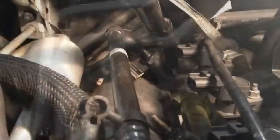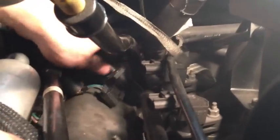So before you take off the valve cover, you want to take off the oil fill, and it will move out of the way so that you don't damage anything. This is out of the way, you want to start unbolting the valve cover by these bolts. There's 4 on. So to take off the 2 back bolts, you have to remove this hose and then remove that plastic piece, and then that will get you access to that bolt. So it can be tricky to take off the valve cover, so you might have to wiggle it.